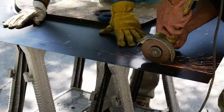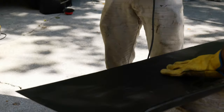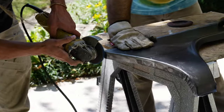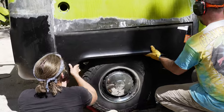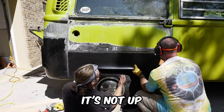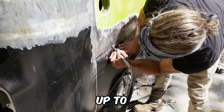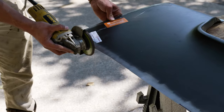Then it was down to making our last cut on the replacement panel. As you've heard many times before: measure twice, cut once. You'll see that I'm still not good at that. Don't forget to clean up any of the surfaces that will be sandwiched together and plug welded. With the final fit in place, I could clamp everything and make final adjustments — using a flap disc to lightly sand down any edges that are a little bit too long.